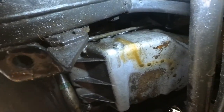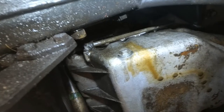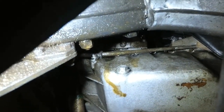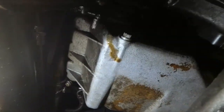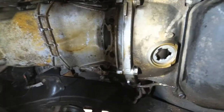I'm not sure what's up there — I don't know if there's an oil pressure sender or what, but this oil on the pan is fresh. There's one bolt way up there that looks suspicious on the oil pan, but I can't see that leaking. After blowing the oil off that bolt, you can actually see it's coming from above that bolt and running down — I think that's the oil dipstick tube. And I wonder if there's a hole in the dipstick tube. There's also oily residue at the back of the engine, and it's hard to tell whether the rear seal might in fact be leaking.